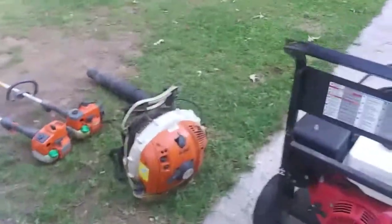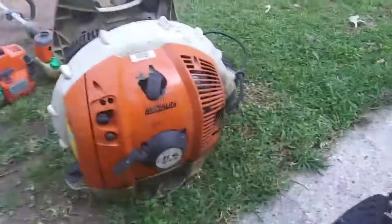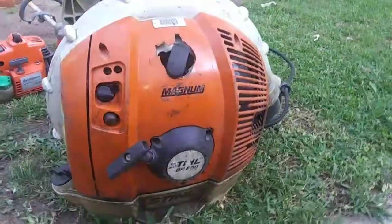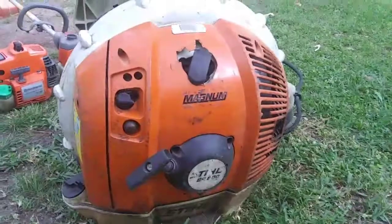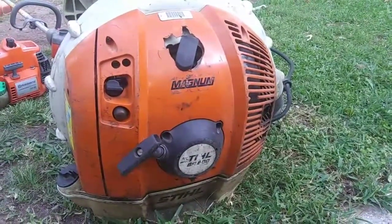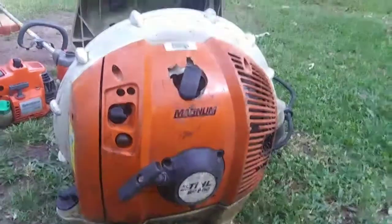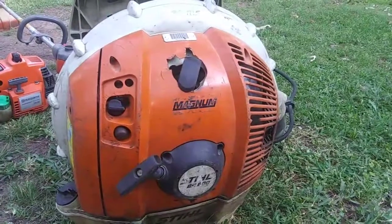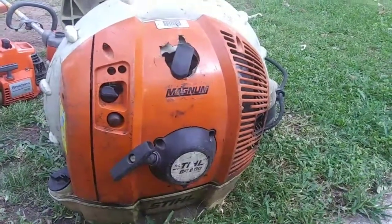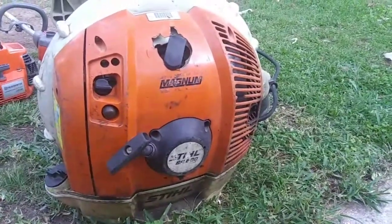I'm doing good, just getting back in the groove here. Notice the title of the video is still the same — we've got a Stihl BR600 blower in. It's kind of on its last leg. I'd describe it like a football game: we're late in the third quarter and we're down by 14. It really needs a repower on it. It's running, but I adjusted the valves — they'd never been adjusted on it. Now it pulls and starts pretty easy, it's just low power. Might show you that here in a minute.